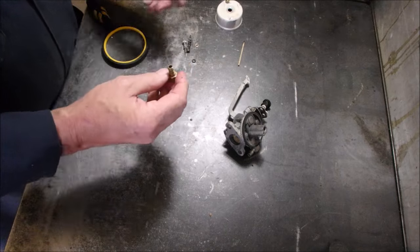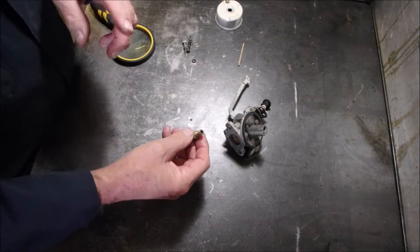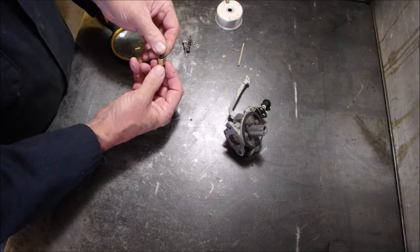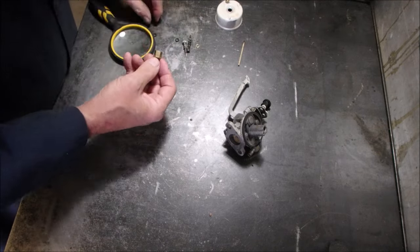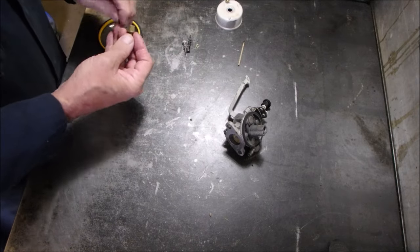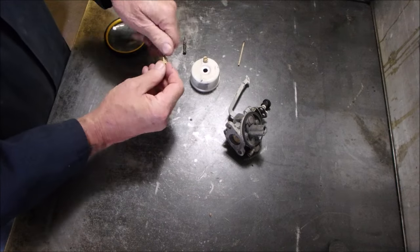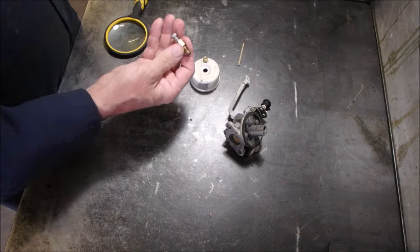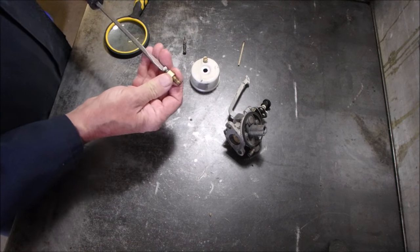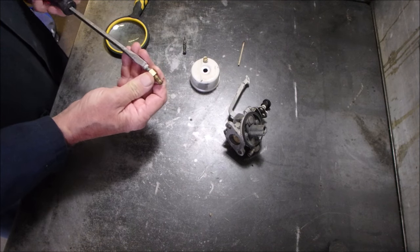And on these old carburetors, you don't need to drill out the jets bigger and stuff like that. My screen's acting up. So, okay, let's just do this. You can take a screwdriver and turn that down, and then bring it back out one turn, or 1 1/4 turns is the one I like. So... half, one, oh, 1 1/2, that'll work.